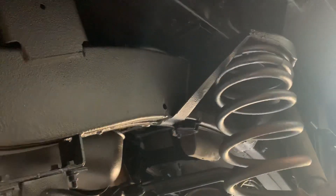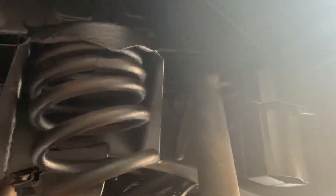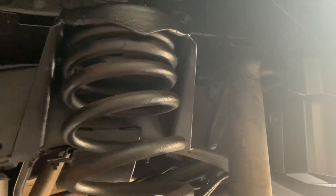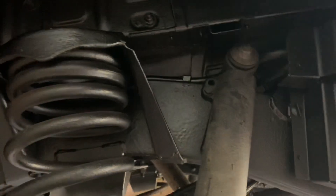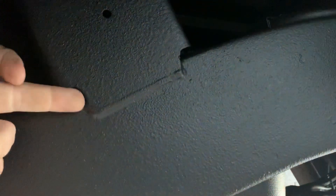Six layers of paint in total on this chassis. They're not overly thick layers, but it's two coats of rust encapsulator, two coats of chassis in one, a wash coat of wax so it goes over everything and soaks into seams and things. We've got seams down inside, spot welded at the bottom that can leak down into here, so we hopefully stop all the rust in there and get at the top of these mounts as well.